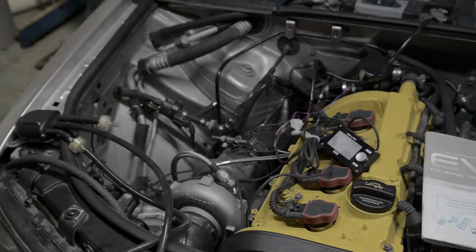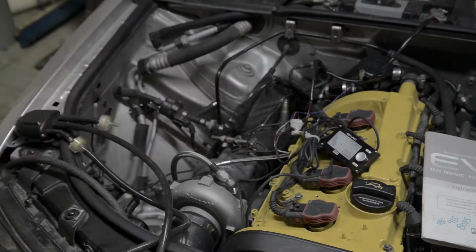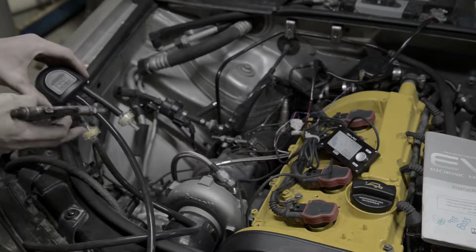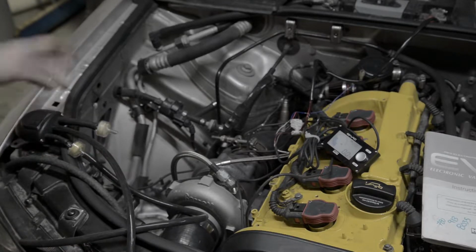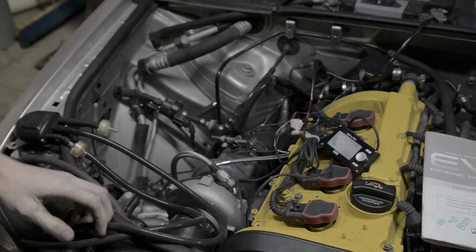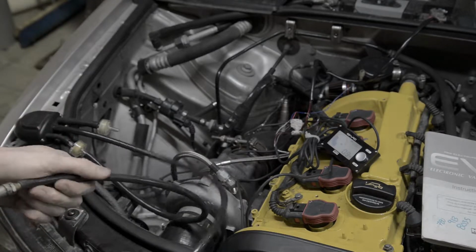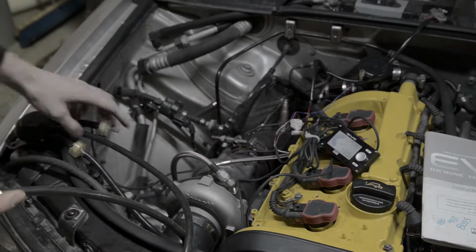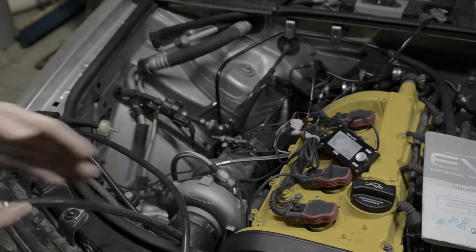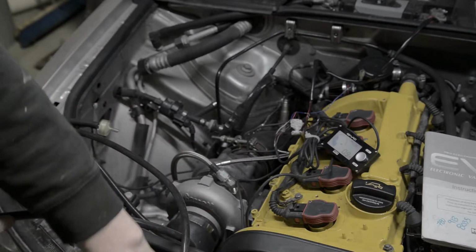Well, the manuals are proving a little bit difficult to understand. So what I've got here, I've got the controller just hooked up directly to the battery. Everything's kind of spread out everywhere. Now this controller has 3 ports on it. It's got one that's got a B on it, an I, and an O. So take the airline. I've got boost pressure going in the B line, and I can see it's reading on the controller, but I'm not getting any air out of either of these ones. So that'll be what this thing is using as a boost reference, but that's it. It's not doing anything else.